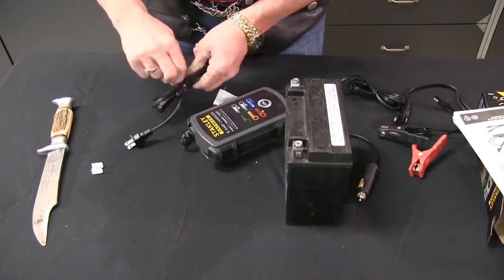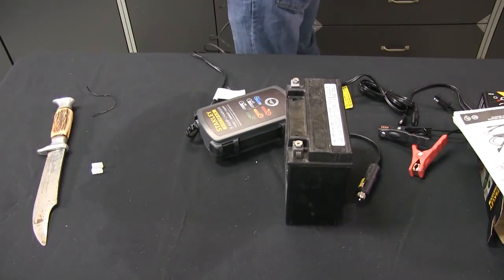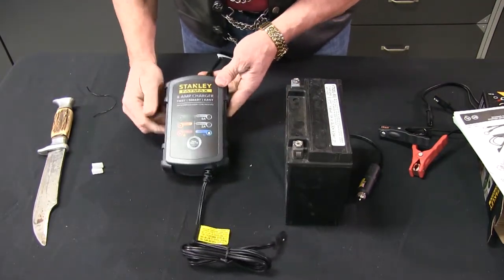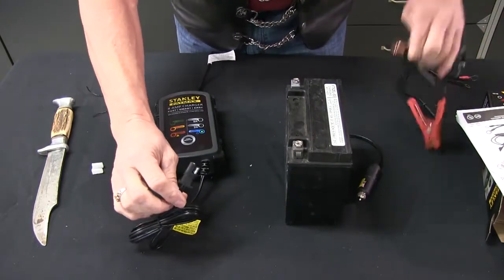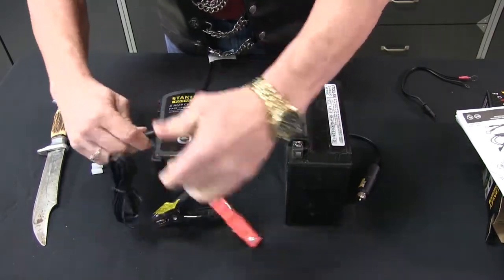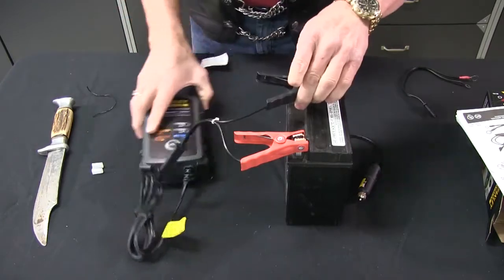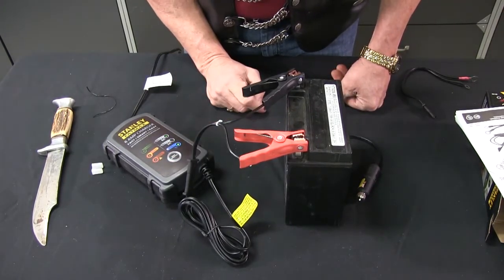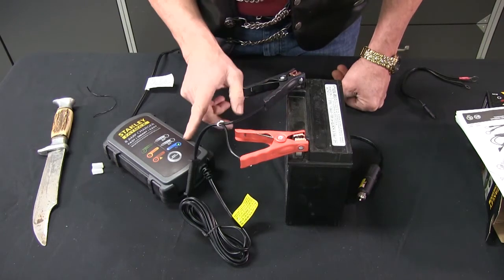Let's plug this in and see if these lights all light up or what happens here. We'll hook it up to the battery — let's actually hook this up and see what it's going to do. There's a plug right behind me. There we go — can you see it? This little green light right here just came on when I plugged it in. Now if we hook up to this battery, let's use the clamps and plug this together. We're hooked up — let's get the red to the positive and the black to the negative, and let's select our mode: 2 amp or 8 amp. It is charging at 8 amp right now. That's just the power indicator.